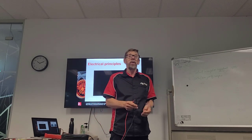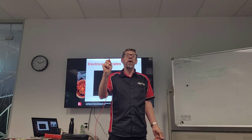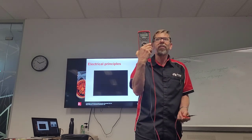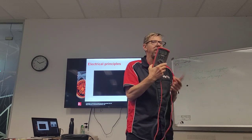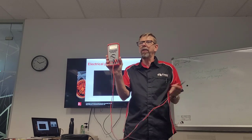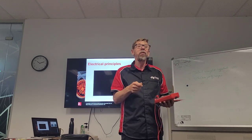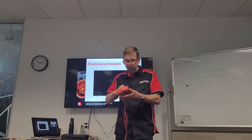Okay, just imagine I'm checking a circuit. I'm going from one point to the other, maybe a ground, and I'm looking for a voltage, but I get ghost voltage. What's that telling me? Telling me I've got an open circuit. Does that make sense? Yes. So ghost voltage can work to our advantage, because if we're looking at a circuit that's got ghost voltage, it's not connected to ground or wherever we're connected to. Yeah, we can use an ohmmeter, but sometimes to use an ohmmeter we've got to disconnect two ends and go to both ends. This way we only go to one end and we can see straight away.